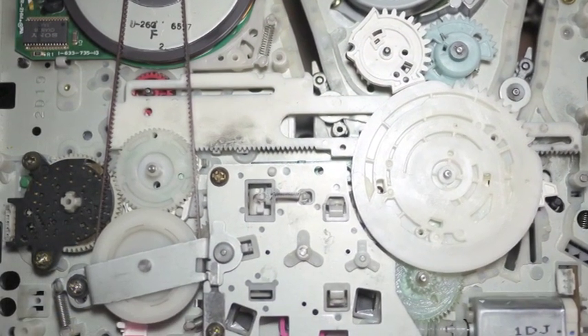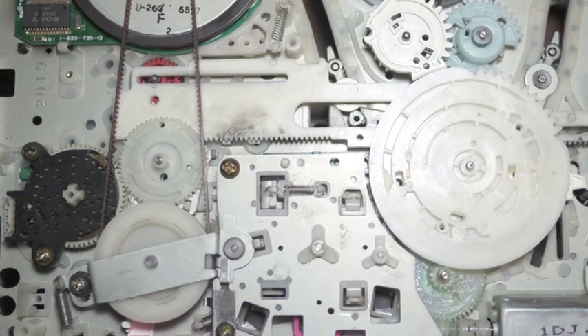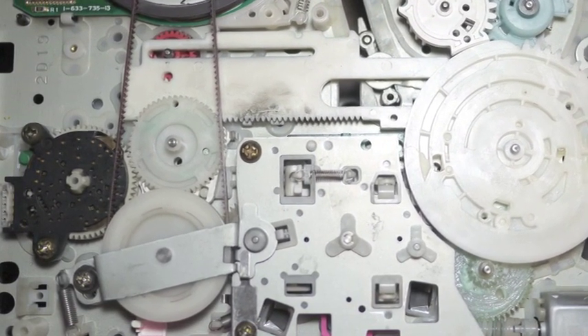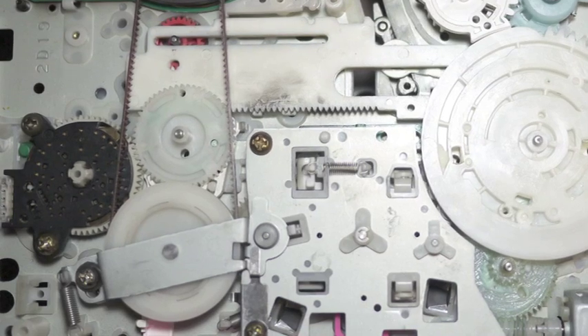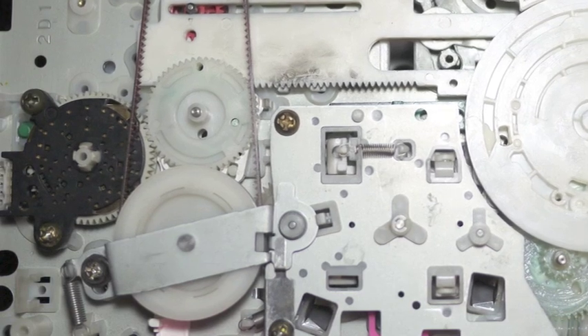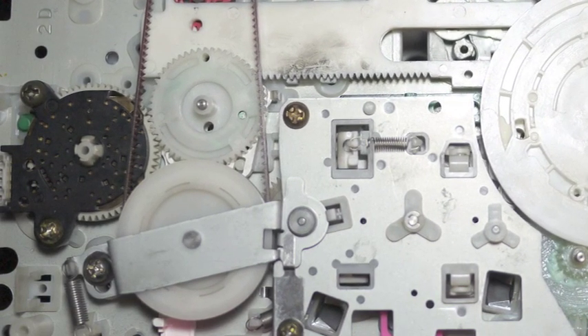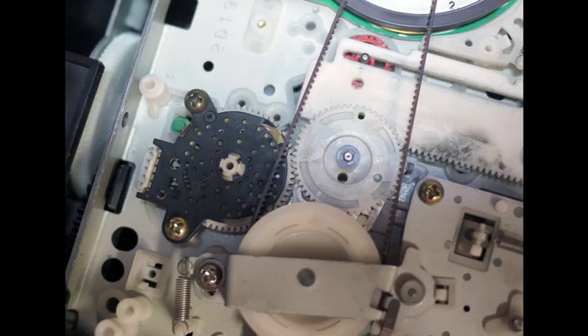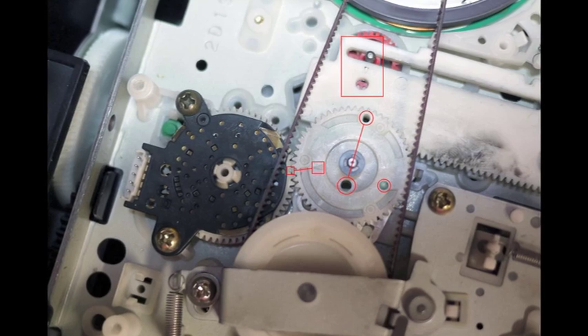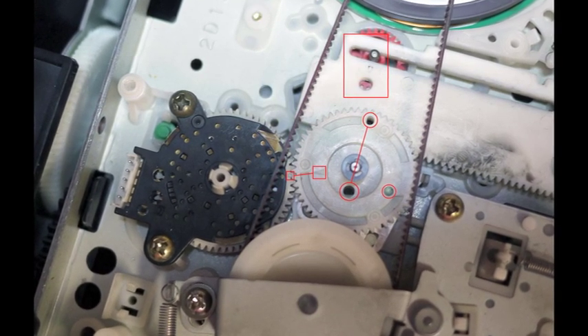Before you place back the main cam, here is an overview of the positions of all the gears placed properly. You need to start with the positions of the gears driving the capstan first on the left side before you can work to place the main cam on the right side. That will be shown in great detail in the next frame. It's important to align correctly the gears that drive the capstan on the left side on the bottom before you work on the right side.